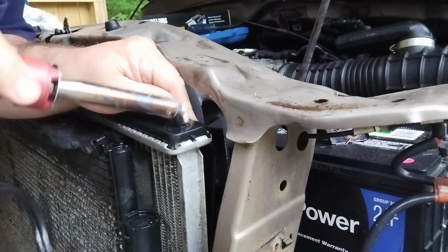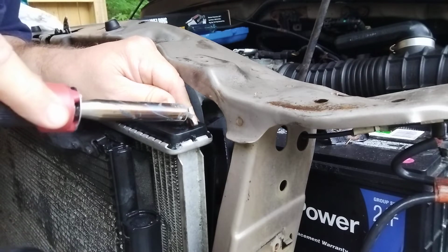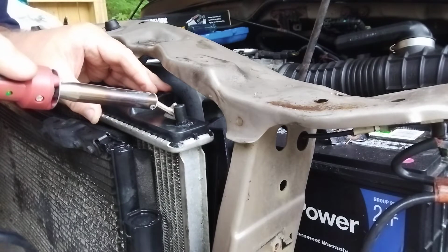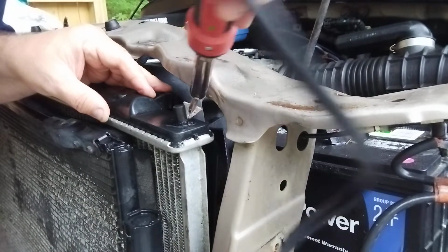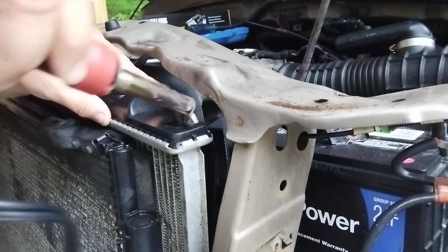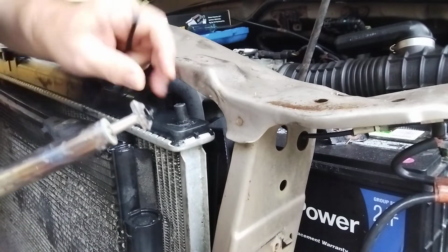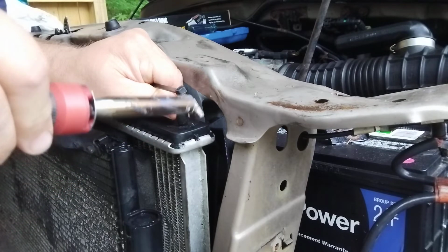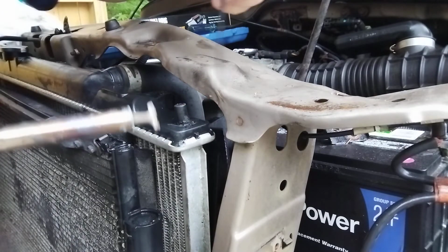And now you're basically blending the two pieces of plastic together. But, you know, I got a little bit of a groove here. So I'm going to have to fill that groove in. Just like any other kind of welding, to me, once you weld it, you got to get it to have some material. So here, I got our zip tie. I got her. She's pretty straight. So let's see what we can do here with the zip tie.